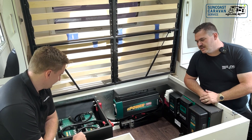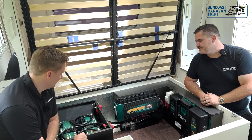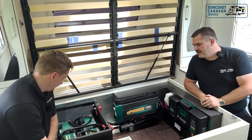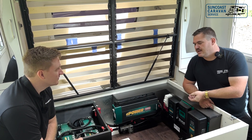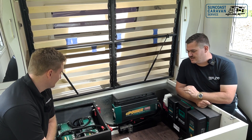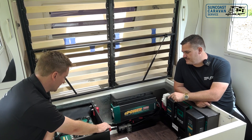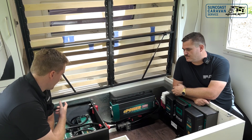We've nut-serted the top of the box so you've got to unscrew your fixings to physically get the batteries out. We've got the batteries mounted up in the box there, and we've got a one-way dust valve in the back so air can escape but it can't come back in if they're hitting some dirt roads. We've also got the kill switch on the side there, and we've got it glanded through the side of the box as well.